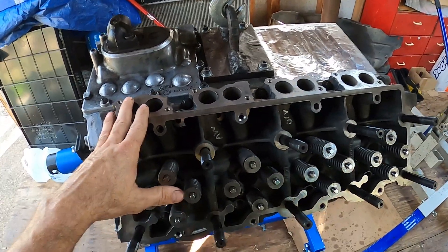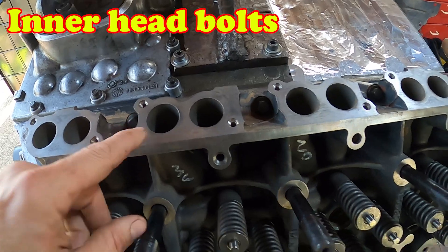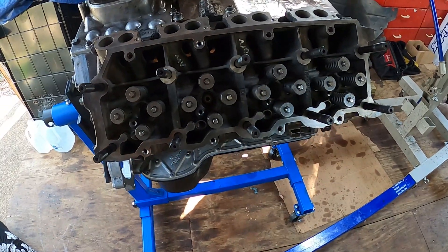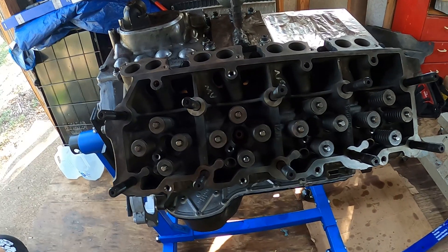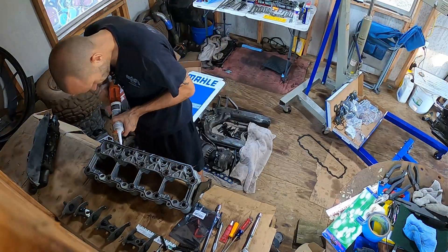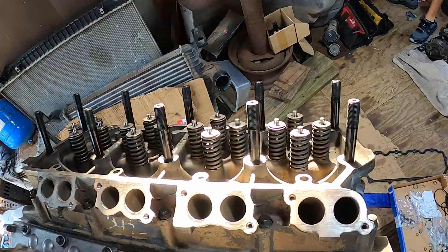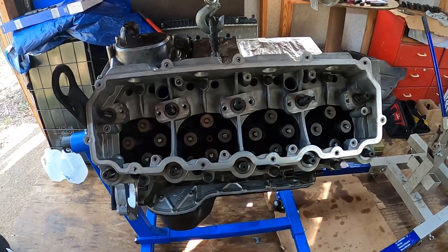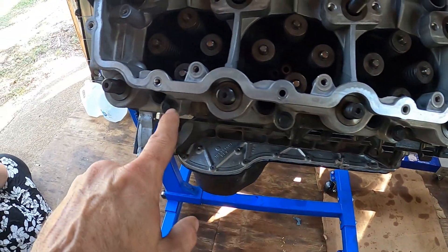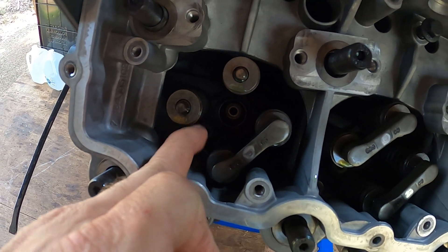Now that we've got it back on the engine stand, I took my five top smaller bolts that hold in the head — you want to make sure those go in before you tighten down the entire head so you don't find out they won't thread in. Now I'm going to grab that rocker box. It's been sitting for a little while so the RTV is ready to go. We got the rocker box sat on, and I took the eight smaller bolts that go in the rocker box and got those in and threaded.